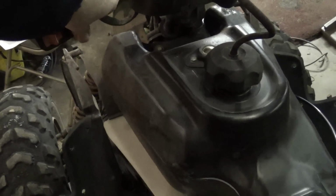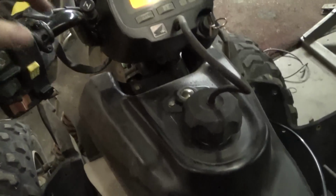Cleaned the carburetor, got it to run, pushed the buttons to shift, and it wouldn't do anything. Used the manual shaft down there with a socket wrench on it, and it would shift no problem. The gears would pop up on here. It would go from neutral to 1 or 2, whatever I shifted it into with the wrench. So the thing still runs decent. Like I said before, it would always start up the same. Starts right up. I did that as soon as we got it, cleaned the carburetor, no problem, but it wouldn't shift.